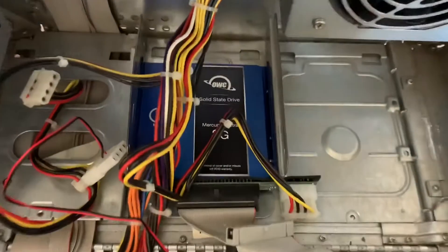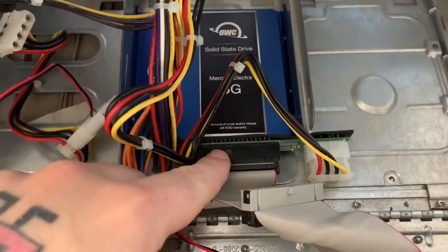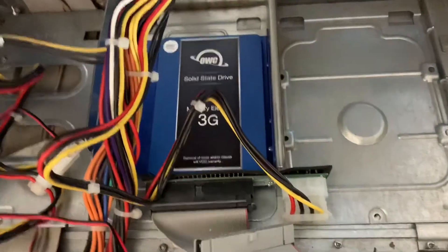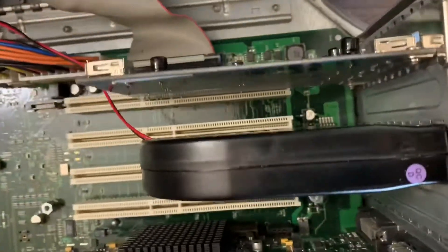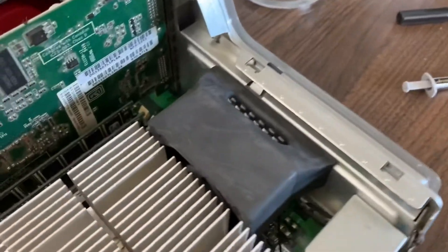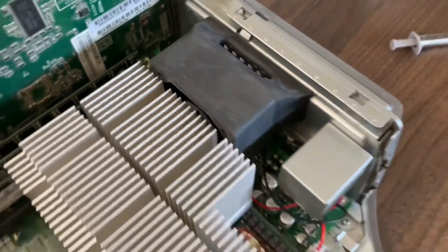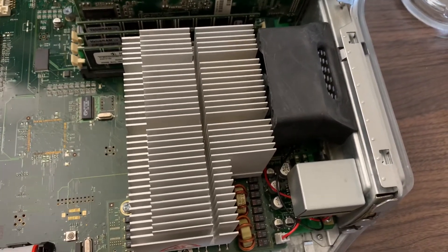A few additions to this machine would include that chip right there, that adapter, which allows me to take an IDE channel to a SATA solid state drive — a zillion times better, in my opinion, than the old school mechanical drive. And my ATI video card inside here — I replaced this fan with a brand new one because it died, and this one moves way more air. And then this monster heat sink — your typical heat sink is kind of small and square and tall, right? This thing is a monster.